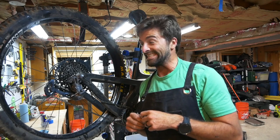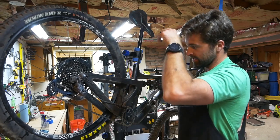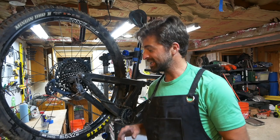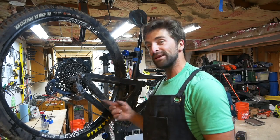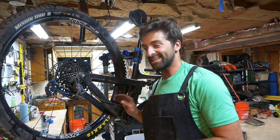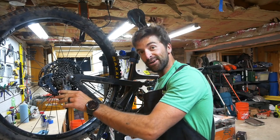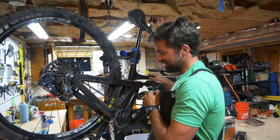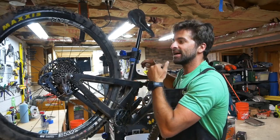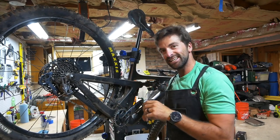We'll give it a few cranks and see what it does — fingers crossed. I made a rookie mistake and didn't run the chain right through the chainstay, which happens way too often. Make sure you run the chain through the chainstay and you'll be all set to ride. Then quickly connect the power link and the drivetrain is now ready to go. I can usually give it one good crank and that sets the power link; if not, a ride will do it.